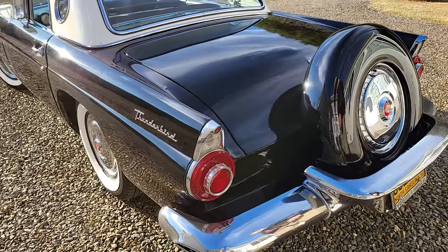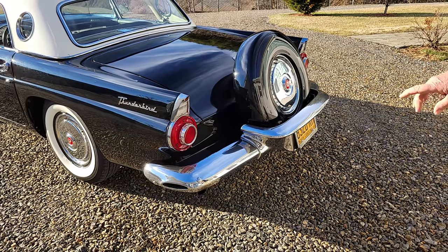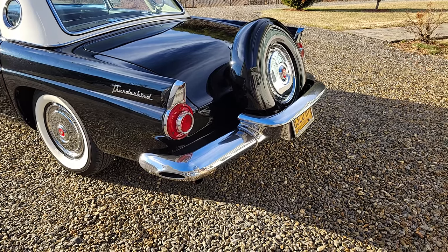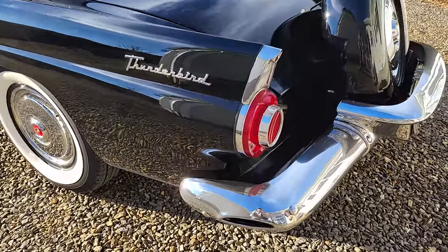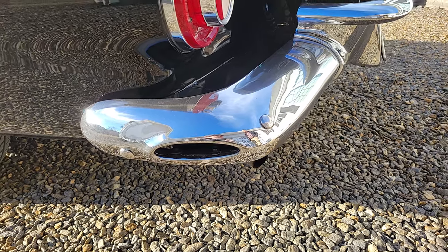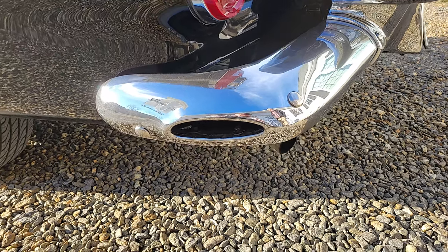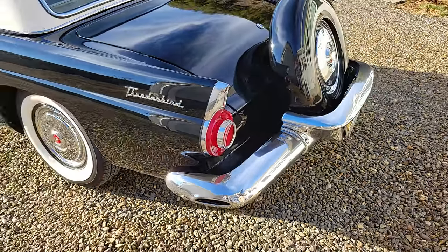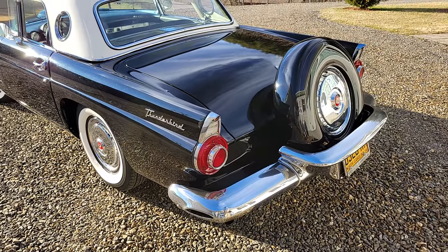Those horns were really bad to ruin your bumper and rust away. On this one, you can see it doesn't actually come out the correct hole because it does mess the bumper up pretty quick. So it's run out low. It's originally set up so the exhaust would come out here, but that would really blacken the bumper up. And moisture rusts it. So it's much smarter to just run it out the bottom. Even though that's a neat design idea, aesthetically, it's one of those things that probably didn't transfer too well practically.